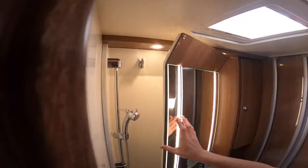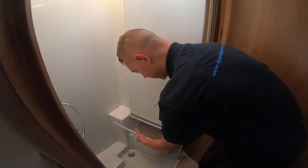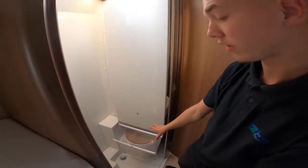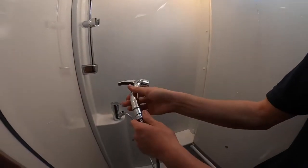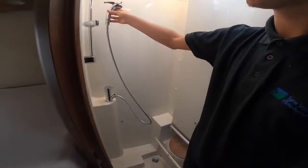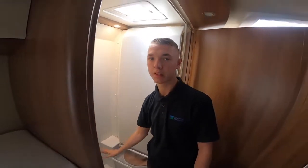Turn the turn-buckle to make your shower cable separate from the toilet area — that helps stop it harvesting water on the top — then pull your screens around. When winterising, always unscrew your shower head from the hose and lie the hose in the tray, with all taps throughout the vehicle open, to stop any water sitting in pipelines and potentially freezing.